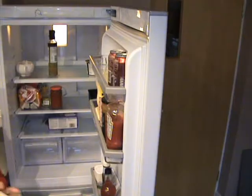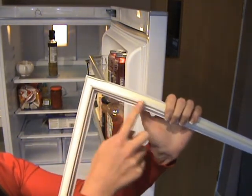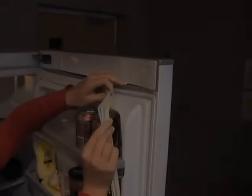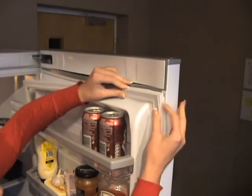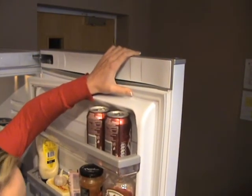To fit the new seal, simply line it up against the groove which you will see runs along each side of the door, and firmly push it flat into position all the way round. The latest models have a tongue and groove moulding as seen in this video.